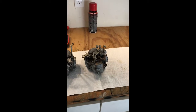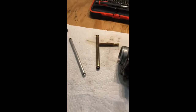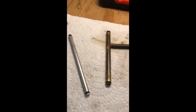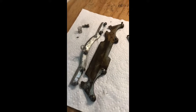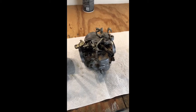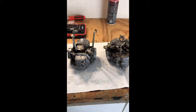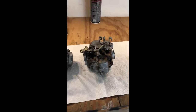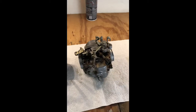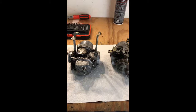Sunday morning and the carbs are apart. They're a little dirty. Those O-rings look a little squashed and flat, so I'm hoping that's really the root cause of those terrible leaks. Lost a few screws as usual, stripped them, have to replace those — it's normal. I'm going to take the bowl off, see what the gasket looks like, but I'll be buying a repair refurbish kit — all new gaskets and O-rings — and get that installed. I think I will not take the engine out for now, just rebuild these in terms of all the rubber, put it back together, give it another try. And if the leaks stop, then I'll go ahead and tear down.